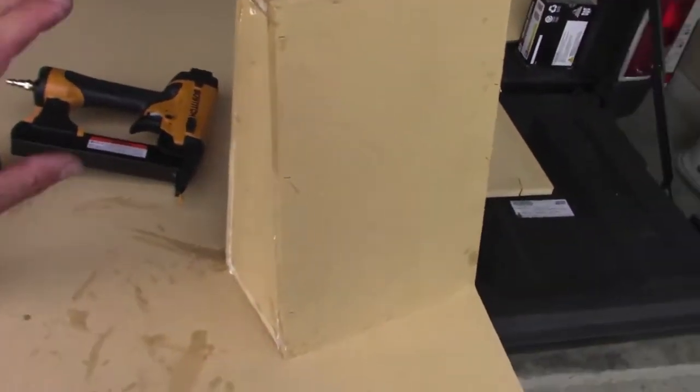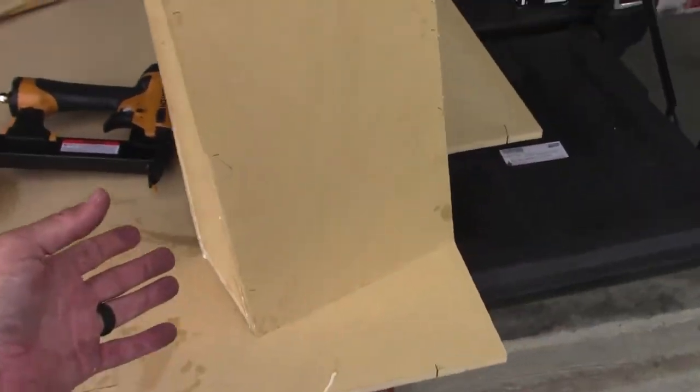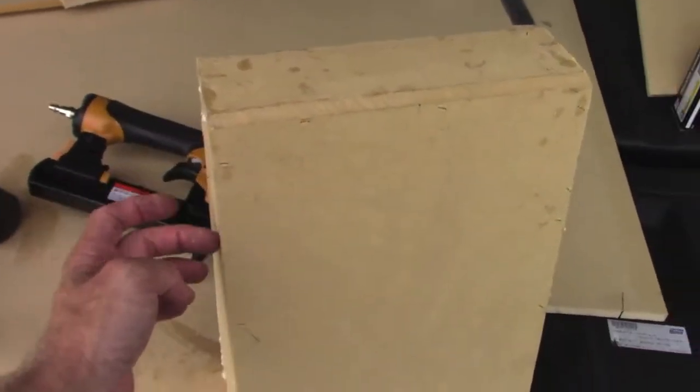Make templates, and we can add our width as we need to. You can also just trace this on the wood before cutting it, which probably saves a ton of time, but use a straight edge — always a good idea. I'm certainly no carpenter, but this is one enclosure figured out before we build both of them. The wood's cut for the second one, but before we assemble the second one, maybe test fit this one first. I'll cut the hole and probably glue on the inside of some of these seams and leave it laying on its side overnight so that seals up real nice. There's not a lot of room for carpet, but there's some — that'll make it fit nice and snug. Under this radius it covers up this opening nice, just enough overlap behind the seat to keep it pinned in place, and that 6x9 opening will be right here where the sound can still come out into the cab.